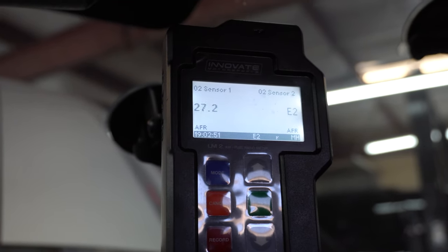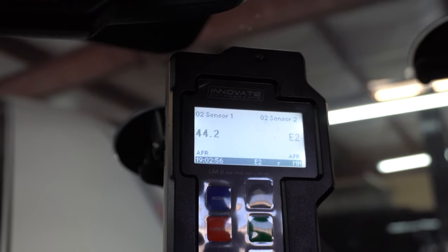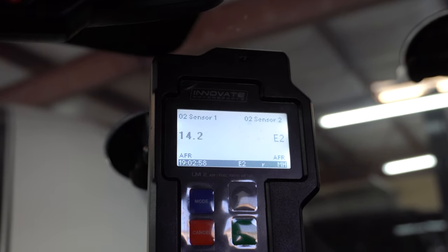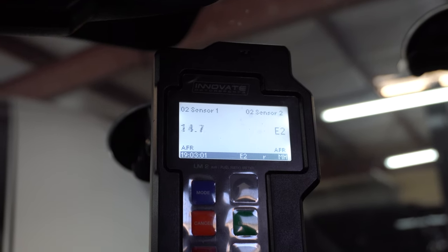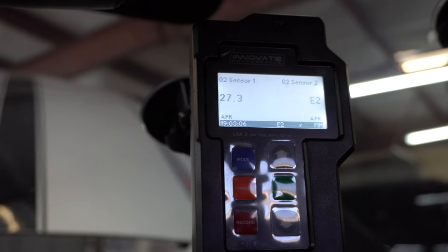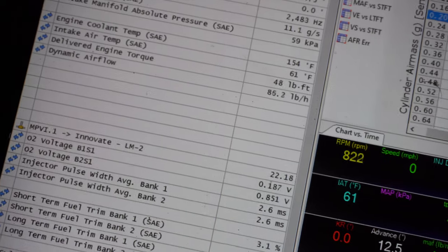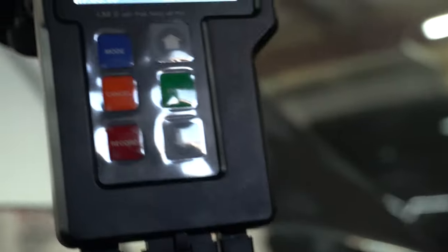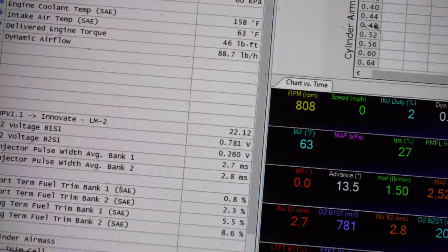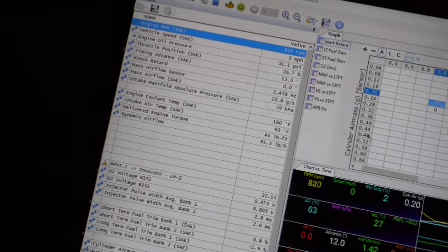One part that kind of sucks about using the tail sniffer like the LM2 is that at idle it doesn't do you really good, but you tune that off in narrow bands anyway. I want to rev it up a little bit — it comes right in and then goes back to being lean once it's back down. I got the idle set right about 850 right now. You can see the Innovate LM2 reading around 22 to 25, giving all sorts of readings — but that's where we're at. We'll go ahead and make some pulls.